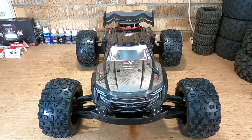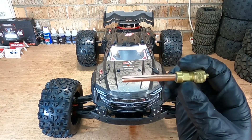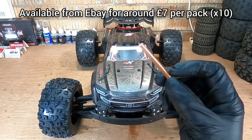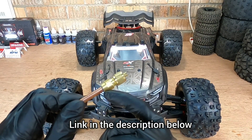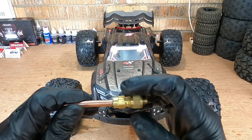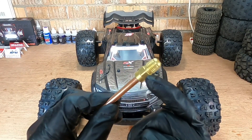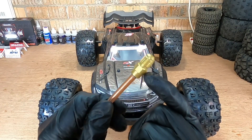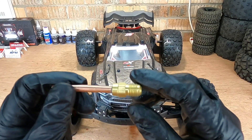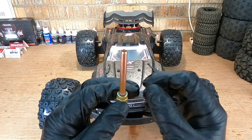Today's video is about venting tires. This is the tool I use — it's a refrigeration access valve, quarter-inch, made in copper with a brass fitting on the end. It looks like it's soldered as well. What I do is remove the cap off the end, and once the cap is removed you can see a nice hex shape which allows you to place it securely in your drill. It centralizes it and holds it in really nice and tight.